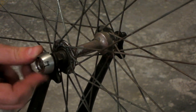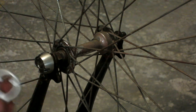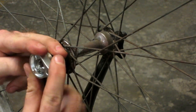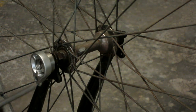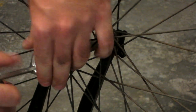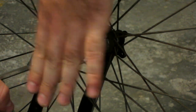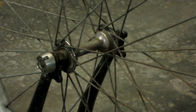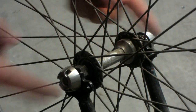I'm keeping those washers on and threading the Nox Nut on. Just like the other one, after it starts to get tight, the outside ring turns but the inside one does not. The key from this package is exactly the same as the one from the skewer package. I align the notches, put the key on, tighten hand-tight, then insert the Allen key to apply torque and get it nice and tight. I find it works best to have one hand on the Allen key and the other pushing on the surface to keep the teeth engaged. Same process on the other side.